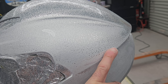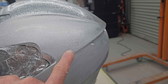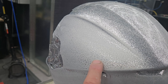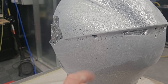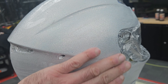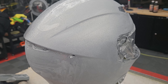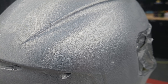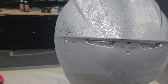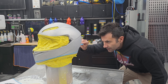I'm sanding this, and you can clearly see the part that I've sanded and the bit that isn't sanded as well — you can see the orange peel there. So if I get it fully smooth, then when I put my top coats on it's going to be nice and smooth as well. Whereas over here it's still going to be rough, so I need to keep sanding until it looks like this — nice and smooth. And then when I put my clear on that, it's going to come shiny again and give me my gloss back. This is just to etch the surface and help my next layers stick.